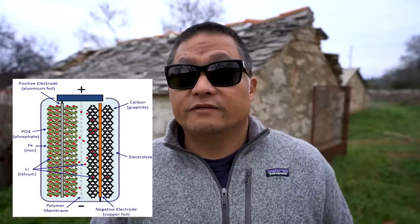Right now I'm more concerned with how cold the battery gets rather than how hot. There is zero noticeable heat — the temperature inside the battery box monitored with my Victron Battery Sense is virtually identical to the ambient temperature of the van. Active cooling is not something I'm concerned with, but I'll look into it when the weather gets warmer. As for compressing the cells, the reason to do it is to prevent delamination from happening internally. With high amperage draws, cells can expand and contract repeatedly, causing delamination that degrades the battery's capacity. With my 0.1 to 0.2C draw, delamination is not something I'm worried about at the current rate of use.